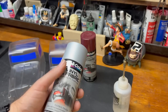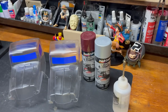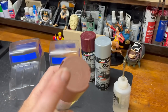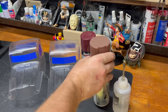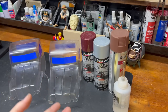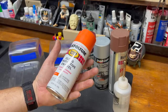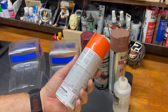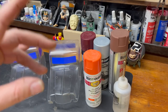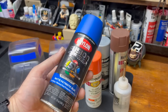To do a patina, you need a single can of the paint dedicated for vinyl and fabric, because this will be your base coat. This is effectively our primer and will act as the bonding layer for all the other paints. Above the silver will go just regular Rust-Oleum Rusty Metal Primer, which has this red oxide color. When sanded through paint, in my estimation, it looks as close enough to rust as possible.